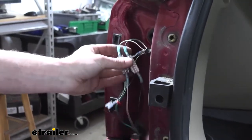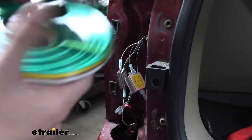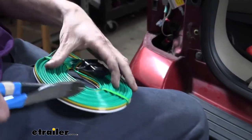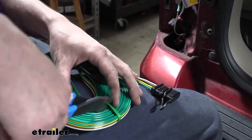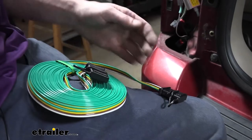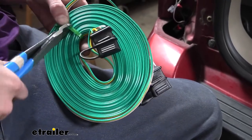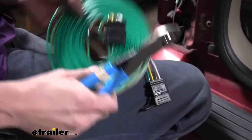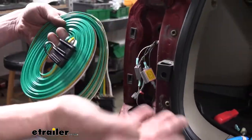We've got some additional circuits we're going to be adding, so let's go ahead and grab our wiring. This is the wire you get in your kit. We're going to be running this from the back all the way up to the front for our connector. You might notice that it has four-way connector ends on it — we're going to be cutting those off. You can leave one of them on there if you're planning on using a four-way in your setup, but the most common connection for a flat tow setup is going to be a six-way connector, not a four-way. We actually sell this kit where you can get just the wire without the four-ways. Oftentimes your tow bar will come with the connector and cable, so I would definitely make sure I'm paying attention to the tow bar I'm buying and see what parts it comes with before making a determination on which kit you'll want to buy.